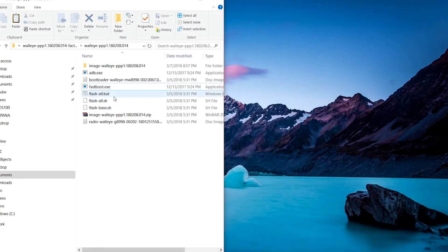Now the first boot might take a while because you have erased everything and you're going to start from scratch, so just be patient. Now once we're back in the fastboot mode, what I went ahead and did was download the latest ADB and fastboot files — I'll put a link to that in the description box down below. I went ahead, downloaded that, extracted it, and placed everything in one folder, and that folder also contains the factory image that I already downloaded from Google. So I'm just going to go ahead and double-click on this flash-all.bat file.